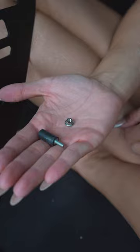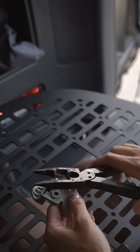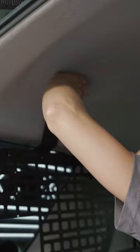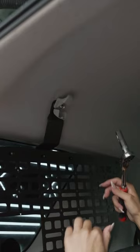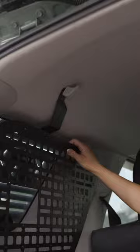Take this small rubber piece with a screw on it and install it onto this hole right here. The hook on my 4Runner has a long piece on the back side — you'll want to cut that off and sand it down. Using my leg to help lift the panel, put the top bracket back behind the hook. The kit comes with its own bolt, but the bolt that came with my 4Runner seemed more sturdy, so I used that one instead.